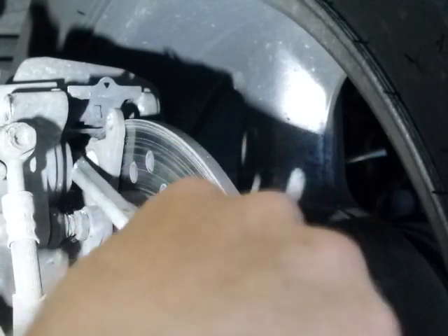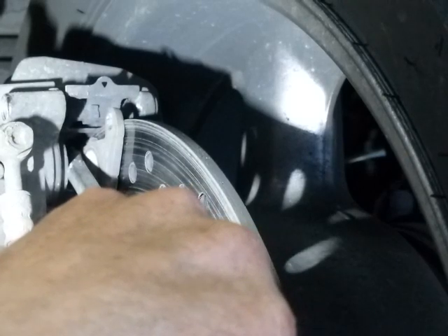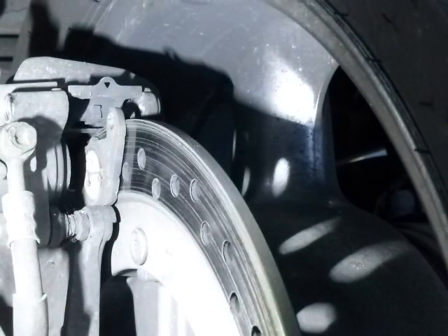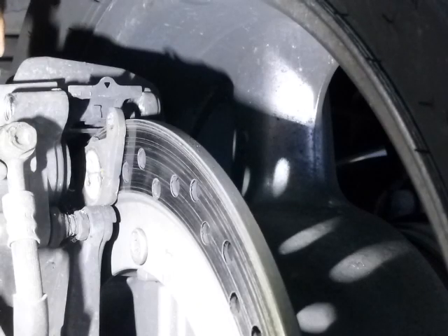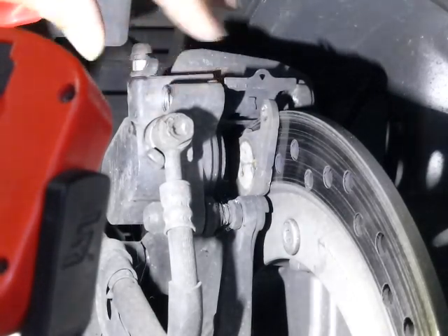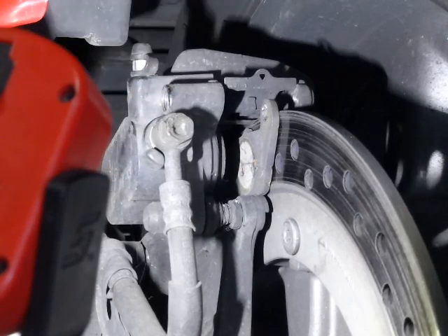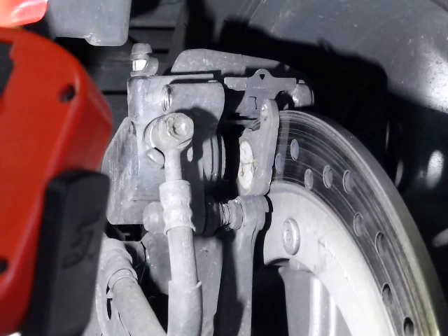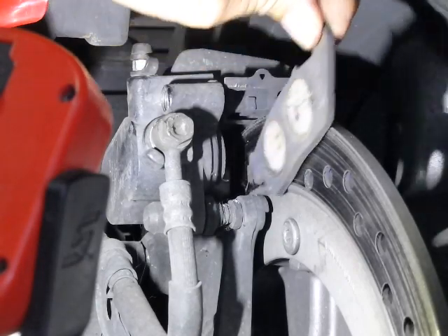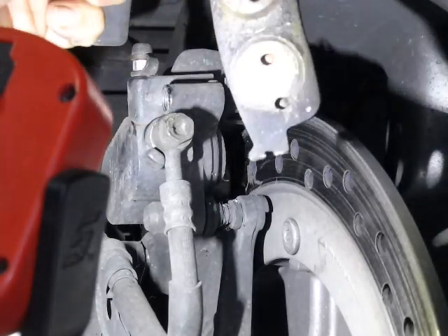You can see that goes back quite a ways. Now if I had brake fluid, I would have cracked this bleeder, hooked a little tube onto it, opened it up, and when you compress the piston back the fluid goes into another container. Then you fill up the brake reservoir with clean fluid, pump it up, and that clean fluid comes back up and replaces it in your lines.